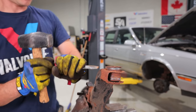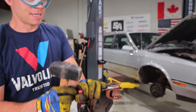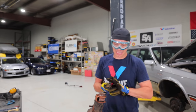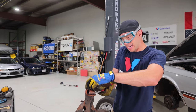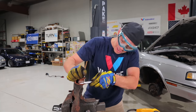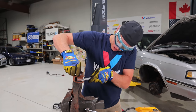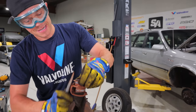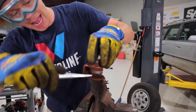You guys can see here this is really, really rusty, but I'm hoping we're still going to be able to press this out. You can see it's surface rust, but I'm just going to clean this up just a tad before we get on to cutting it. There it goes — and look at that. The crazy thing is at first when I looked at these I thought there was a metal sleeve in the middle, but there actually isn't. So the bushing has a lot of the structure that holds this control arm together on the outside — which seems very 80s GM to me.